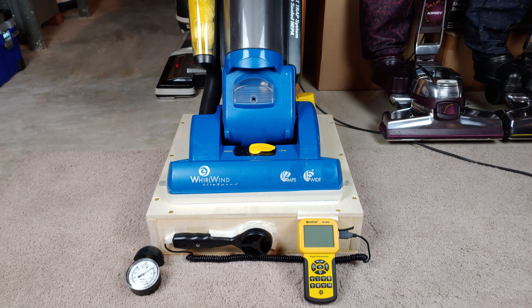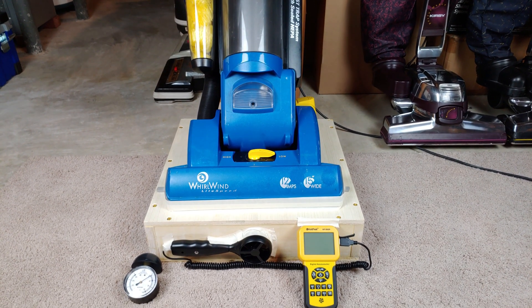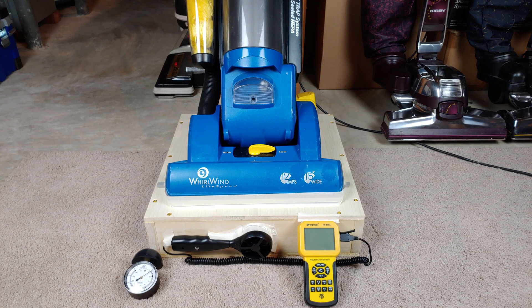The filter that is in this bin right up there really has to stay there. If I were to go and remove that, the machine would get abnormally low flow — much lower than just say the filter reducing airflow by three or four CFM or something like that. It's much more than that, because the filter creates the seal. So I'm going to have to use this machine with the brushroll spinning, because you can't turn it off unless you pop the belt off, and I'm going to leave the interior bin filter right where it is.